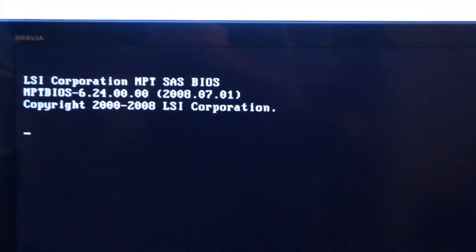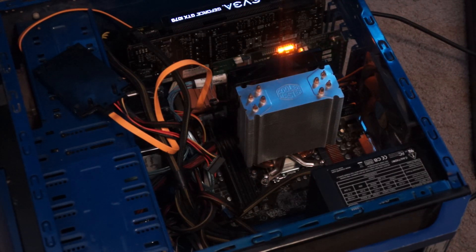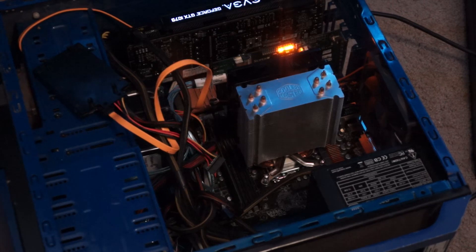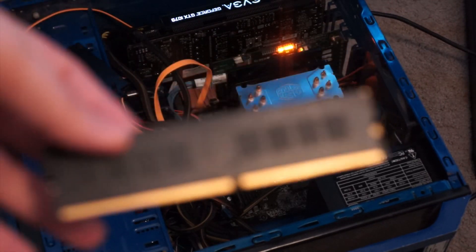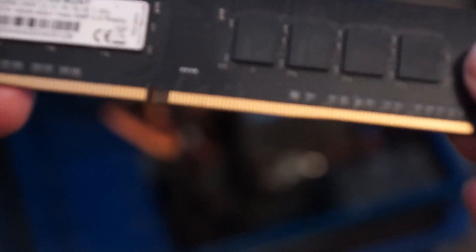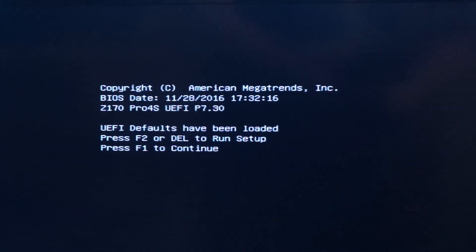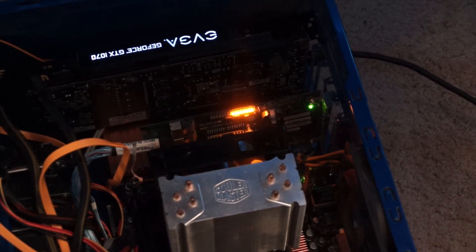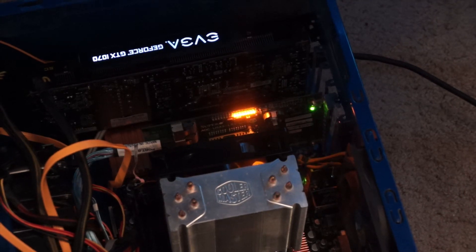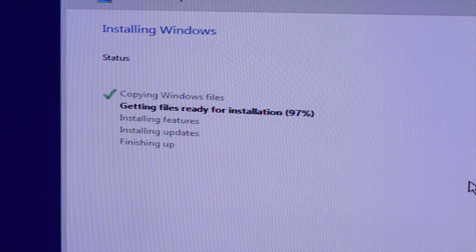It's booting. So good news — she boots now. Bad news is I had to take one of my RAM sticks out to do so. I don't know if it's the slot or the RAM stick. I'm worried about it being the RAM stick because one of the traces is slightly scuffed and I don't know if it's that or the tray on the motherboard. But yeah, that RAM stick just died — awesome. Oh well, I'll replace that eventually, but let's get that card ripped out and continue with installing Windows.